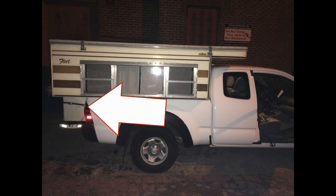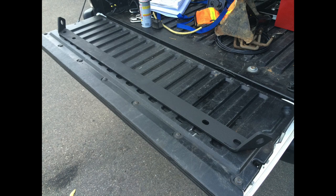To get the truck ready for the camper, the first thing I needed to focus on was proper mounting. When I first brought it home I was using one single strap around the tailgate hooks — absolutely not secure or safe. I wanted proper mounting brackets. I have a whole separate video about mounting to a Tacoma, but the gist is: new Tacomas have composite beds, so you can't drill structurally sound holes. Four-Wheel Camper makes a special bed bar that uses the existing mounting holes for the bed-to-frame connection to give the camper a place to mount onto.